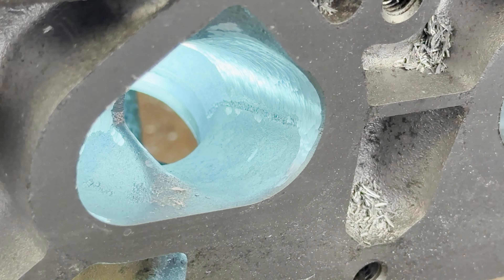Now we're at the bowl area. The bowl area is this area right here, all up in here — this is the bowl. Sometimes we call it the pocket, right? Because it's a pocket port. Anyway, this is a full port, and we're going to blend everything in that we did on the short turn on the walls here, and then we'll do the center. What I don't want you guys to do is — you'll see that this area right here wasn't ground, and it's not ground because this right here is a slope. When it has a slope and it goes into the seat, this area is actually bigger than the valve seat, and what I don't want to do is make it even bigger.